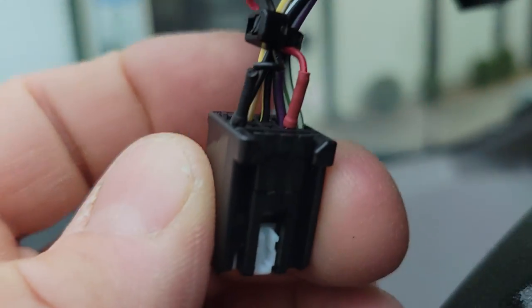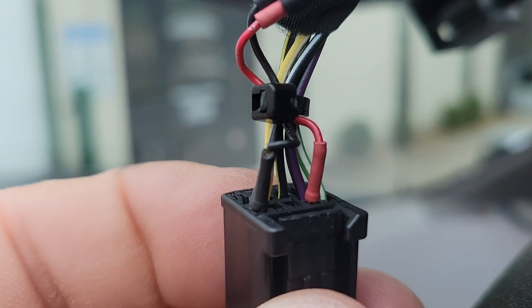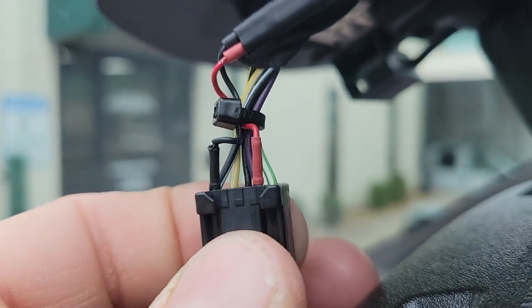These mirror tap harnesses are incredibly delicate and the blades — my two tips are: take the blade and with a little tiny pair of pliers, very delicately bend just the tiniest arc in it. They're straight when you get them and they'll just slip out and wiggle out of the hole over time. So put a little tiny arc in it with a pair of pliers — not a lot, not trying to do anything crazy — just a little, that gives it some extra tension.